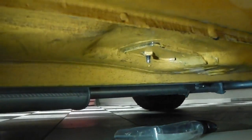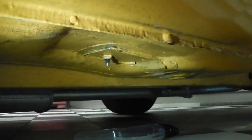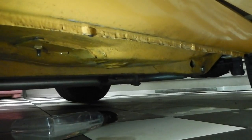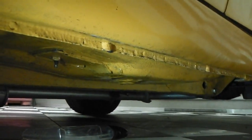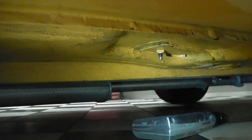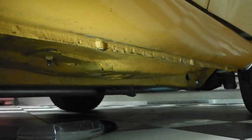We'll do that now. Right guys, what have we got? You see that the APC is starting to break down the dirt there. Look, we're getting the yellow back. I'm going to be looking out for any stone chips and stuff. Now this is all Gravitex under here, which is easy to over repair. You can get your yellow paint, which I've still got a litre of left. I've decanted some into a small container. We've got a small modelling paintbrush. We go over and touch in any stone chips that have hit the Gravitex so that we get a uniform yellow. There may be nothing, there may be no damage.